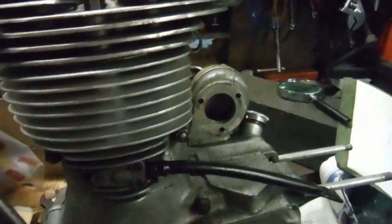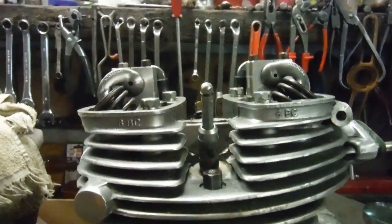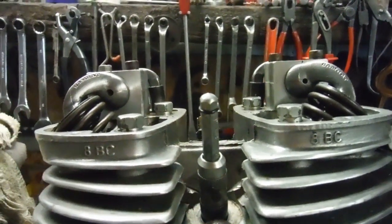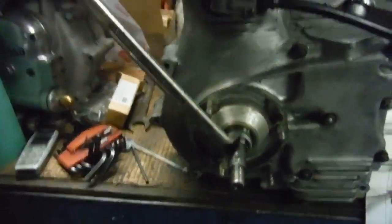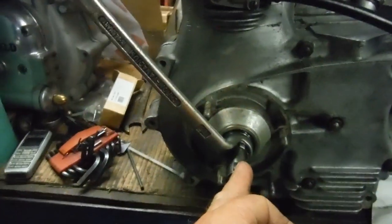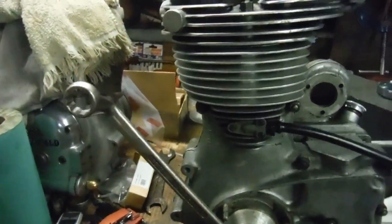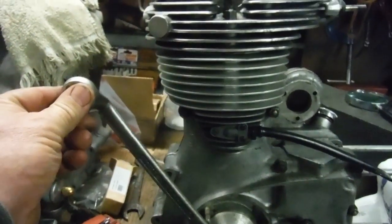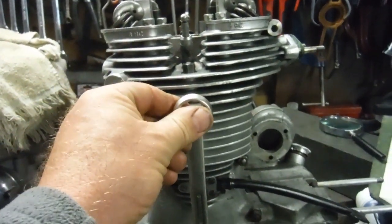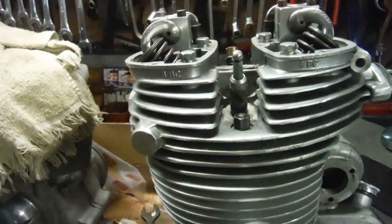I've also found another thing with this spanner. I've got my top dead center tool in there, and I found that the spanner won't actually fit the splines and point straight up at top dead center — but moved round a notch, when I back it up to there and get it pointing straight up, I'm actually at the lower of the acceptable full advanced ignition timing figures.